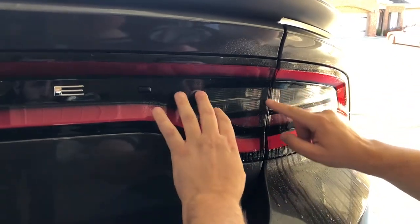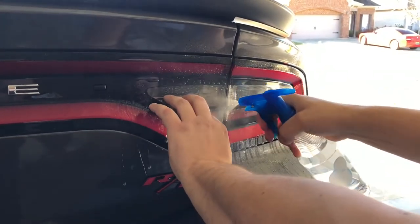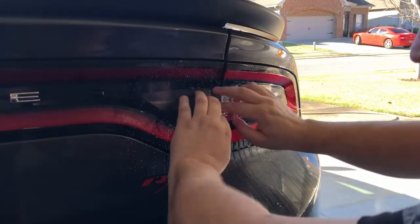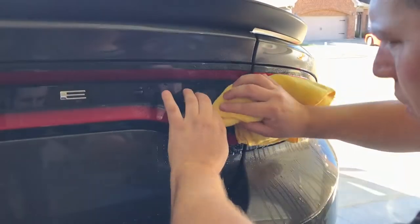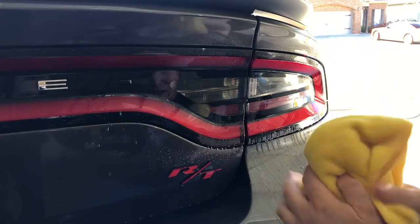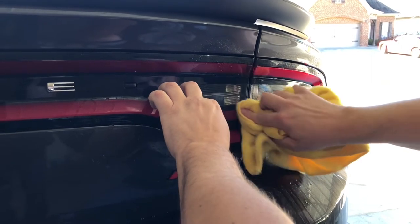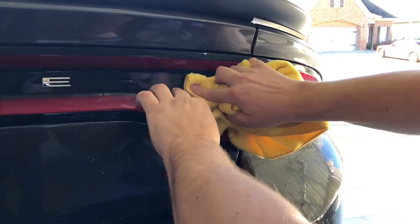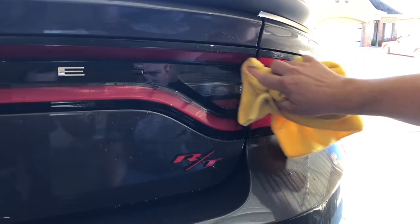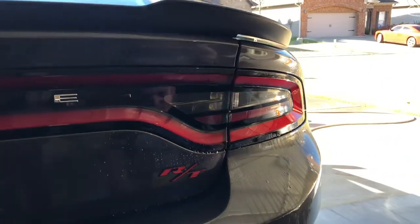Make sure that's wet with your soapy solution, then line it up — line up your edge here. Once you get it all lined up, you can take your clean water and spray it over the top, which starts moving that soapy solution out. Get your towel, start from the center pushing out. Applying medium pressure now that I've got it kind of locked — go from your center, push out in all directions. And that's pretty much it, the tint's on there.